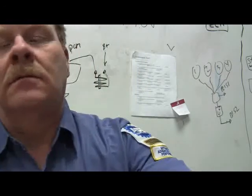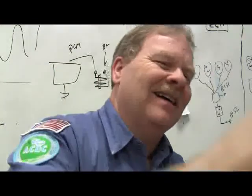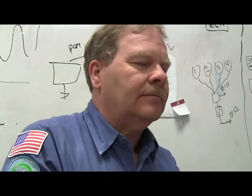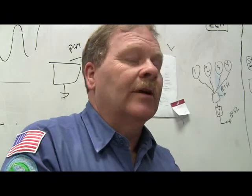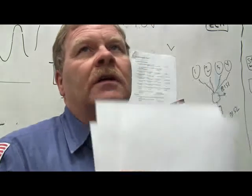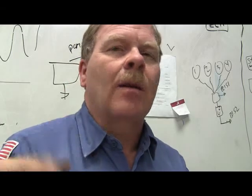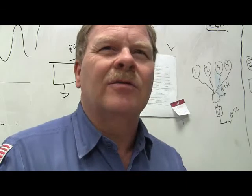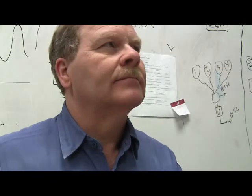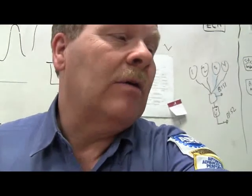What was number eight? I don't remember. True. Now, on that gear noise, won't a helical gear make less noise than a spur gear? Yeah, spur gears are noisy as all get out. You're right about that. But as far as the gear rollover noise, it's a sort of a rattling noise when the engine's running and it's in neutral. You'll just hear the little bit of gear moving in there, but it doesn't mean there's a problem. Put a thicker oil in it. So, yeah. Now, what test is it? It was supposed to be.